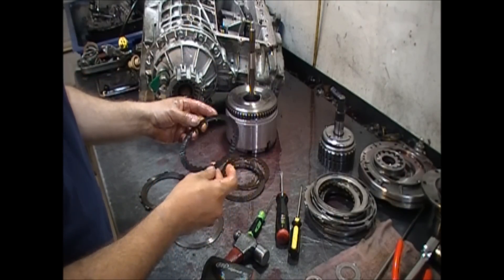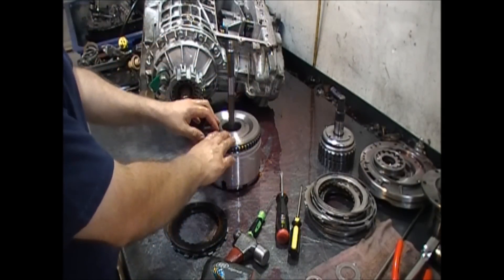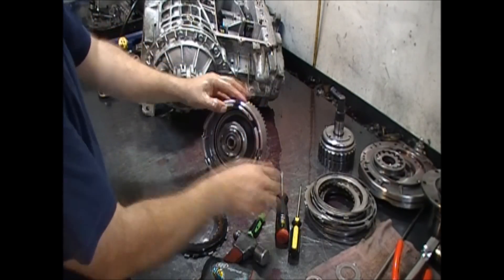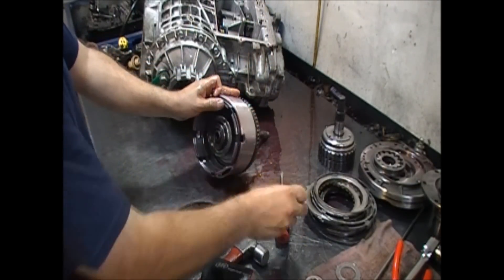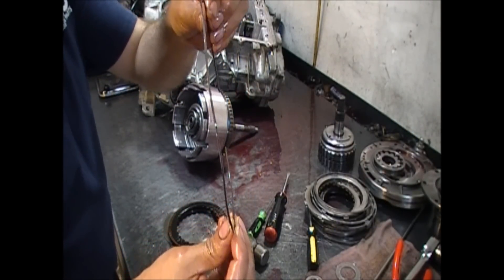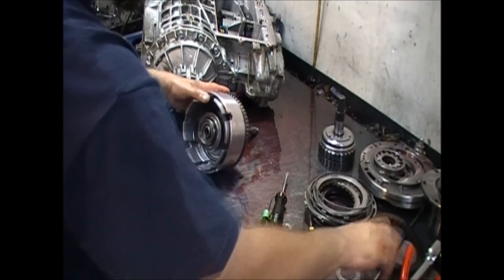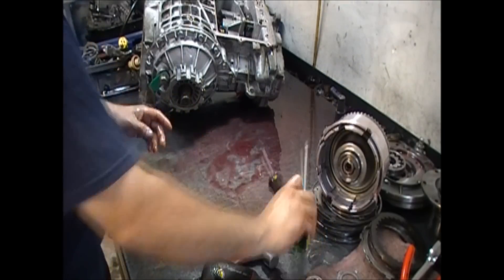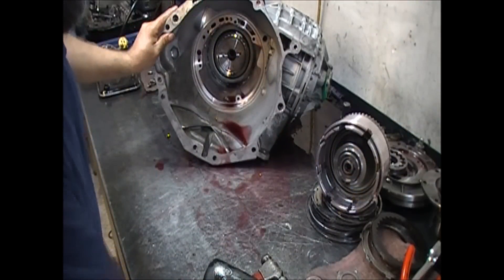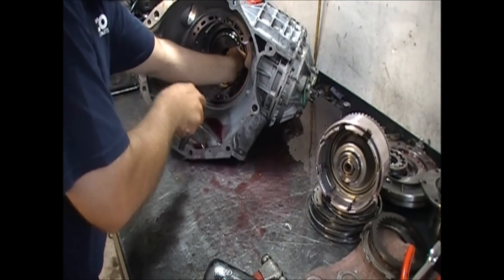When we put this back together we're going to check our clearances on this drum. I'm going to go to my foot press, get the input shaft off, then disassemble here to make sure all our lip seals are where they're supposed to be and none are missing. This is the other snap ring — it's a wave snap ring. Before I do that, let's finish digging into the barrel of the case. We already found one issue that I believe is part of the problem. I'll get my long screwdriver and take the two-four piston housing out.